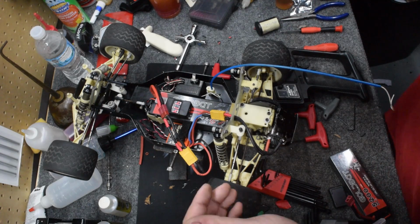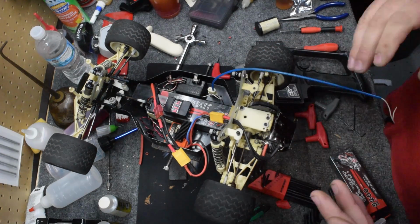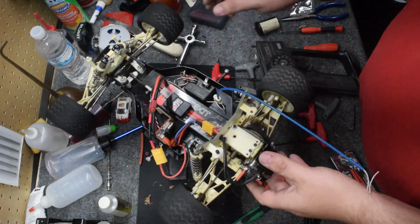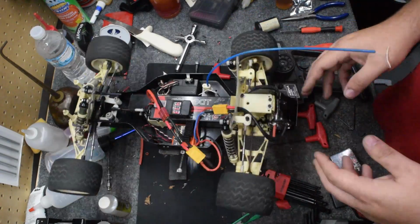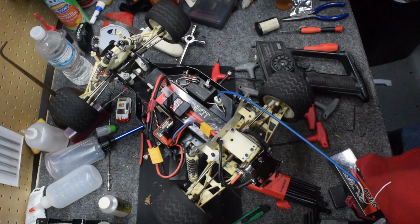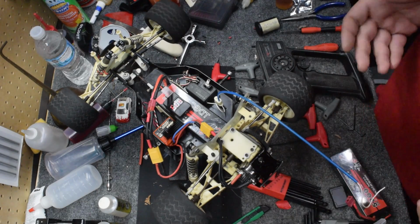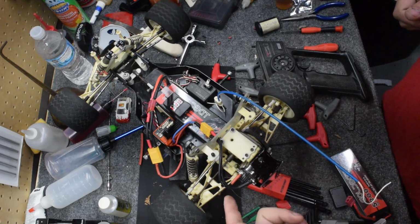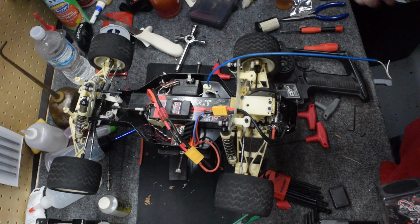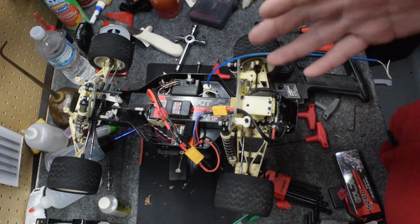So you've got to make sure that every bearing is completely free. You've got to make sure that the suspension travels as smooth as it could be. Because if you've got one hiccup somewhere, let's say you've got a bearing in the front that's dragging, that's going to cause you issues when it comes to setting up, which is then going to cause driving problems, and then it's going to end up slowing you down on the track because you can't get the consistent feel that you're looking for. All of that matters. Same thing with the motor. If you can get your motor to free up and spin 5% faster than anybody else, that in turn is going to create shorter lap times and get you the wins that you're looking for.